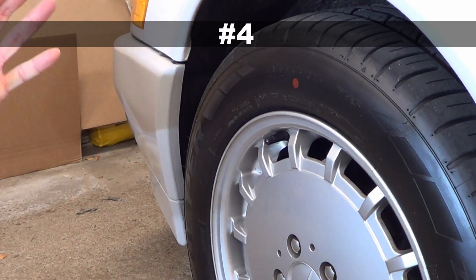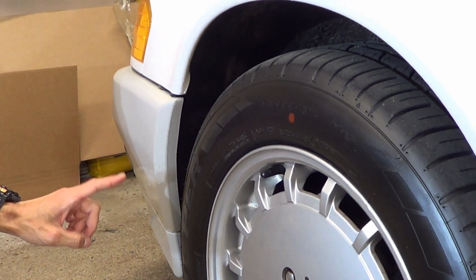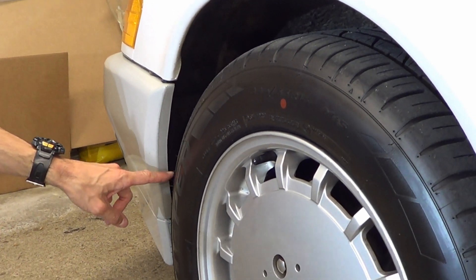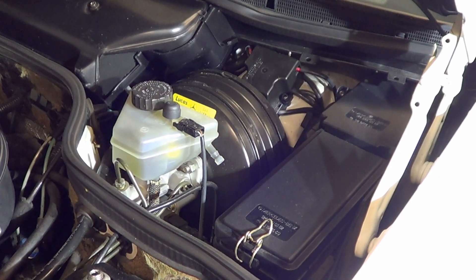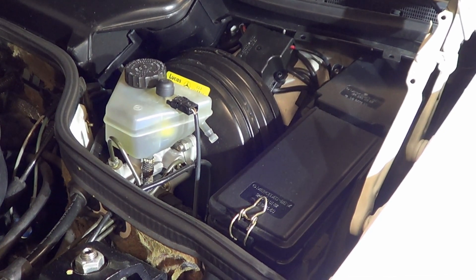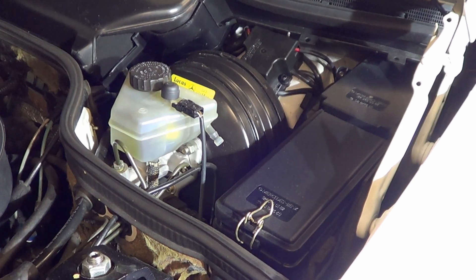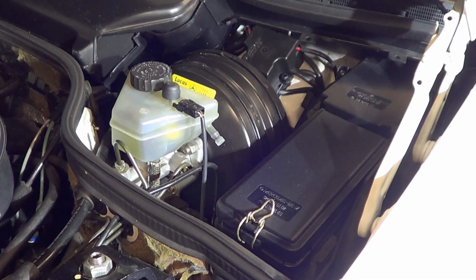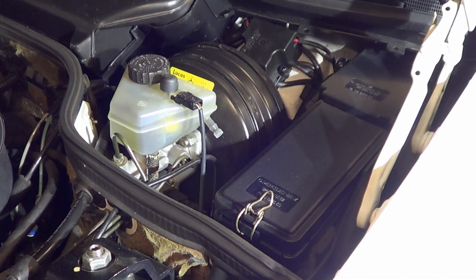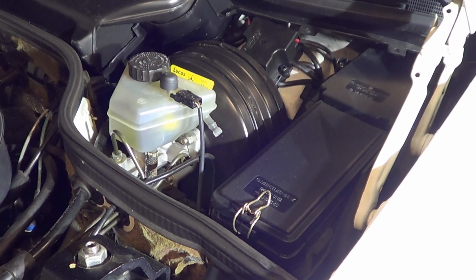Number four: there is an ASR pre-charge pump, and it's either in the driver's side wheel well behind this plastic or underneath the brake fluid holder. This pump works with the brake fluid. The pump has a few metal gears that over time can get gunked up. This doesn't mean you need a new pump — the pump just needs to be removed, opened, and the gears cleaned. It's a messy job as you're dealing with brake fluid.